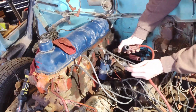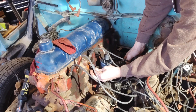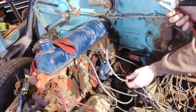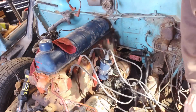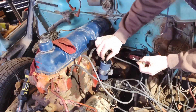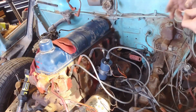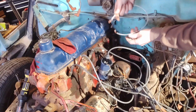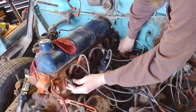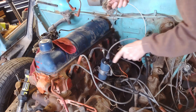Careful, careful — make sure there's nothing sitting on the engine. Still not getting anything. What the hell? The 24 volts really cranks that old starter — I like it a lot — but if we could just get some fire out of here I'd be so happy. We've got voltage there, so why can't we get anything? We'll just pretend we are the points — manual points — and that's happening. So what's happening down in the distributor?